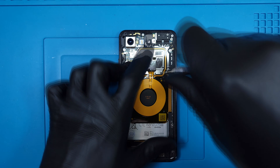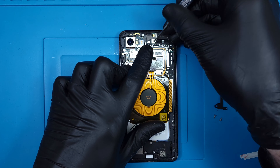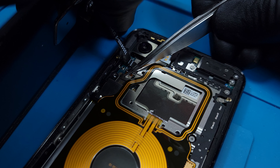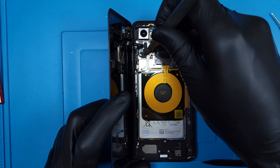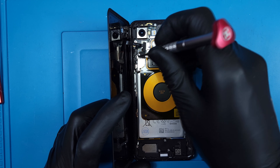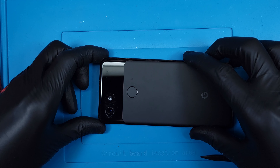This would make a really cool transparent phone — with all the gold and black going on, it would look great. The oddly bent fingerprint cable gets snapped back on the board. We take the small plastic bracket, thread it into place, tucking just under that copper coil ribbon. Two more screws and we're ready to stick it back together.